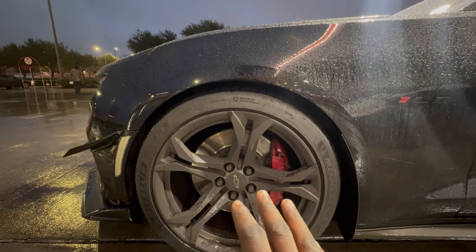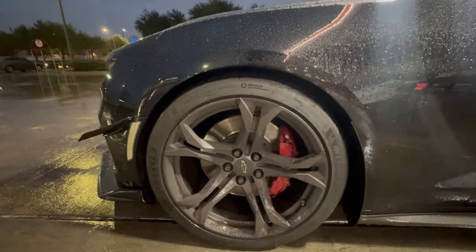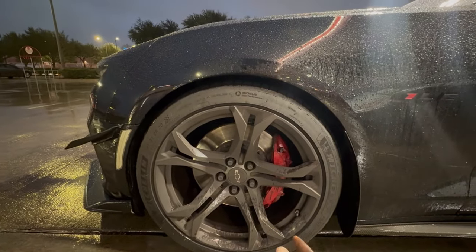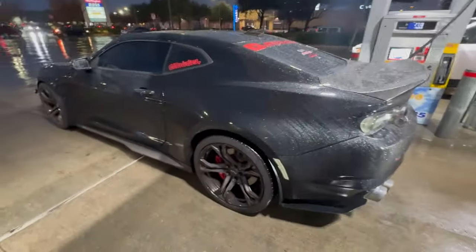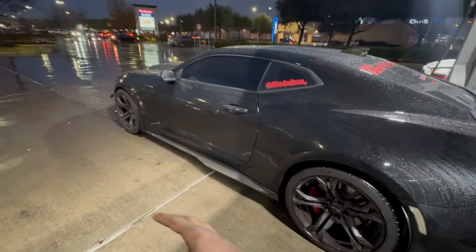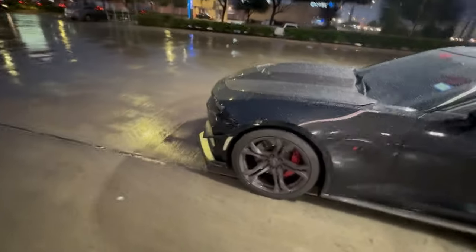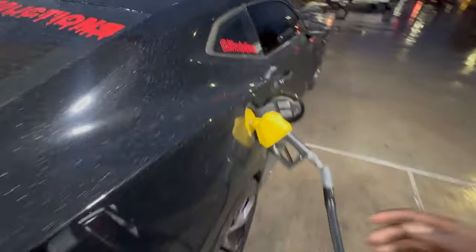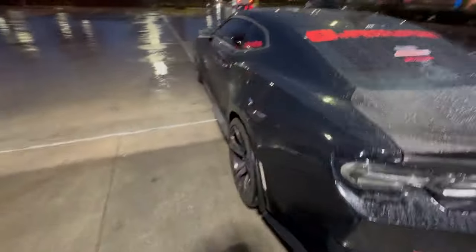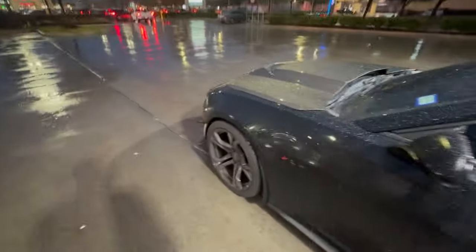So this is how the front sits stock with the 35 sidewall. I'm not gonna lie, it sits pretty good, but it's kind of higher now because the rear is on the 30 instead of the 35, so my car is kind of doing that rake look. The 35 in the rear plus the inch and a half drop would definitely take the stance to a completely different level. With the mag ride it doesn't lower as much — the lowering springs I'm going with do an inch and a half on the regular SS but on the 1LE they do an inch and a quarter, so we'll see how it goes.